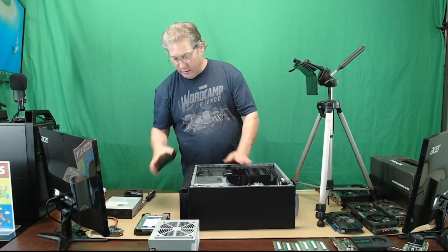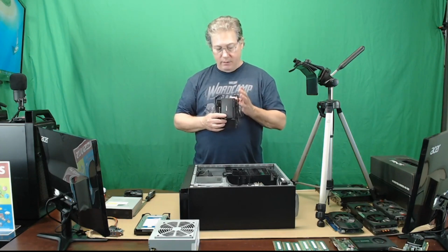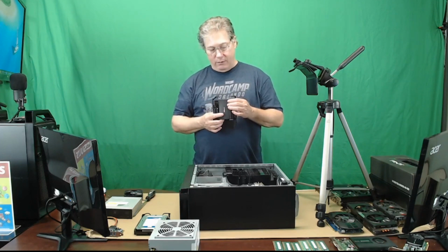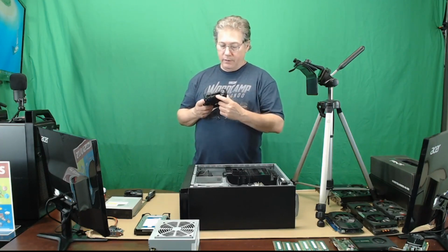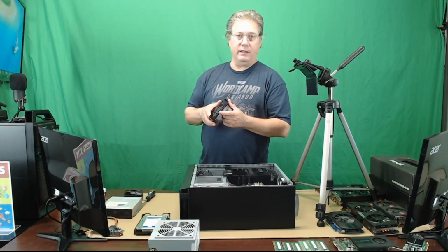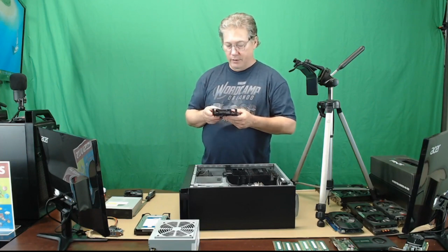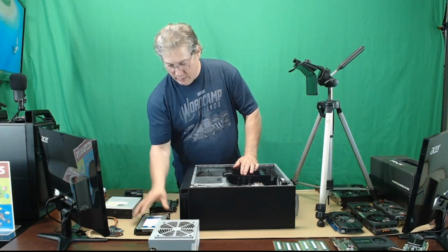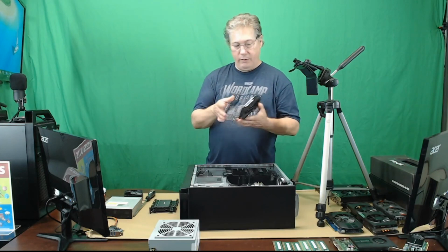The other thing I did is I purchased a PNY SSD. I picked it up for about 30 bucks. It's a really good value to go with the SSD. All your newer systems are going to have those, but these older systems didn't, and this was bare bones, so it had nothing. Under the SSD, I stuck an old hard drive in there. It's only 160 gigs, but this is not going to be a system that needs a lot of storage. If it does, someone can add it later, but I just thought I'll get that in there, give a little extra, and then a 500 gig Western Digital. So I already put them in the caddies.